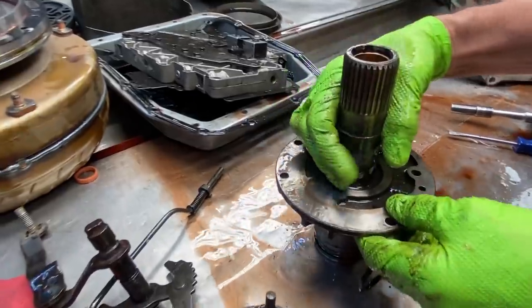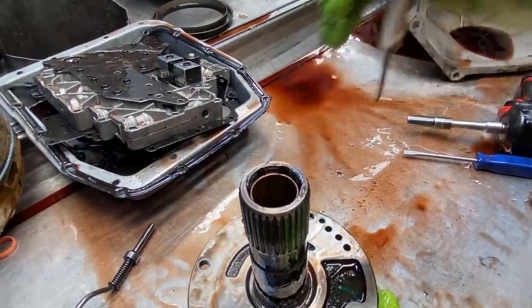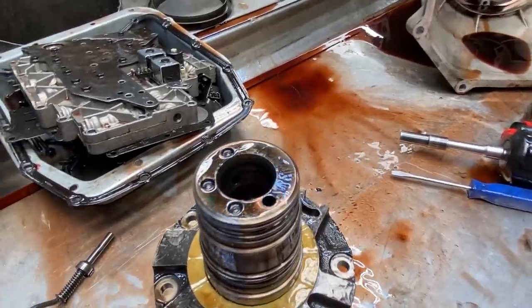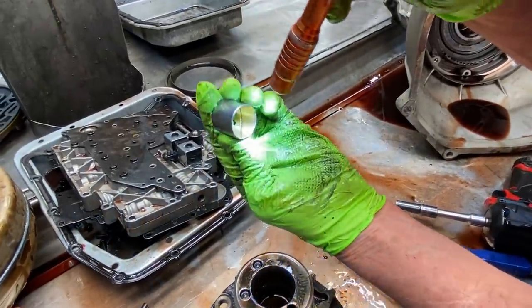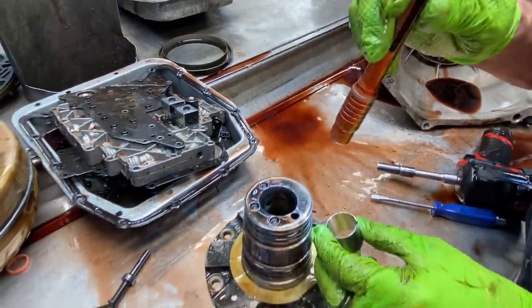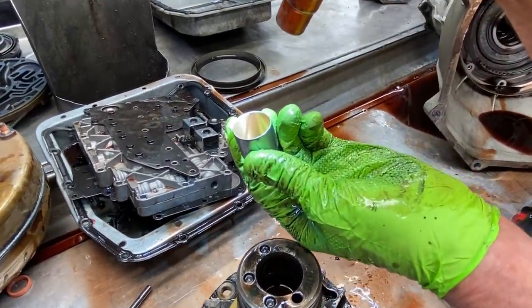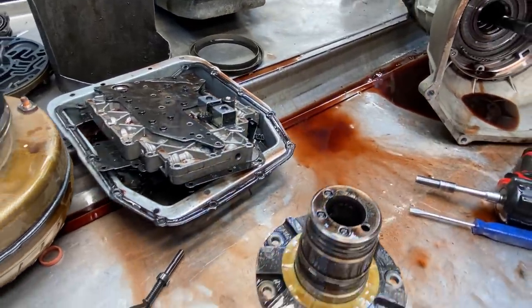Sometimes these rings when I take them off will even have a wire ring under them to keep the ring pushed out — look for that. The pump stator looks really nice too. Now you can see this bushing right there — see how it goes down and kind of slices downward at an angle? The new one loops down and comes back up. But the bushing that goes in the other end is a straight drop at an angle. You don't want to get your bushings mixed up on where they go.